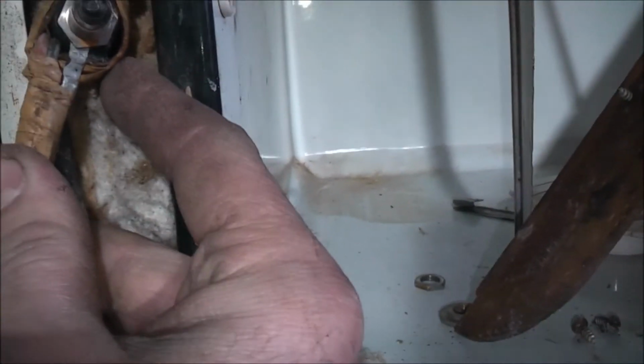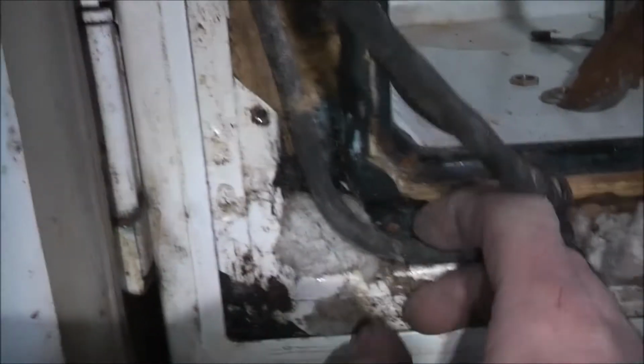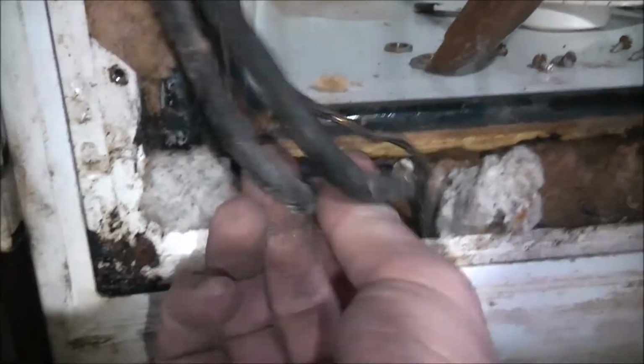Now I've checked these wires here, these are still rubbery, so they go inside behind here to the socket. So I can take this off here and desolder it. This is all soldered here. The solder job goes in here. Take under this sticky tape and just replace all this wiring in here. Well, I'll do that last. I'll do this thermostat first.